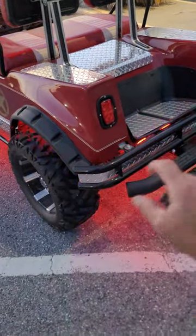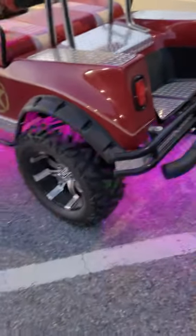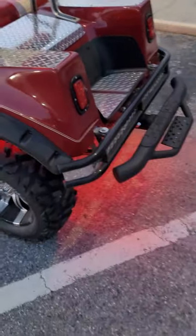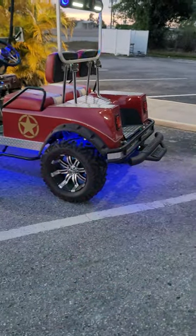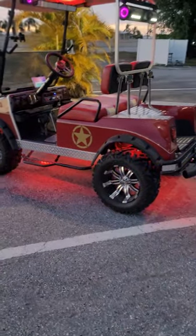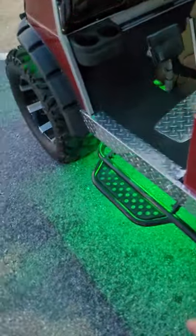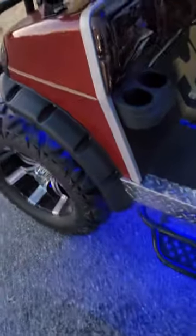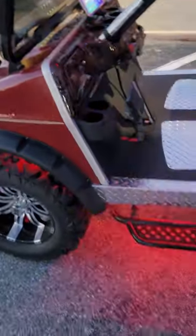That area was all open right there, so I enclosed it with aluminum. It has a 2-inch hitch adapter right there so I can tow a little trailer — I have a foldable trailer if I want to tow around. It's been a little bit of work. I ended up cutting a little bit on the front on the tie so it won't hit, and I cut a little bit on the adapter over here so it won't hit when you turn.